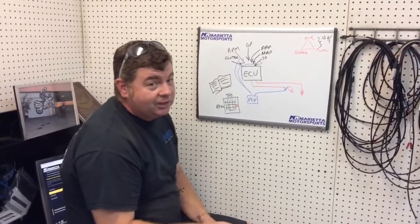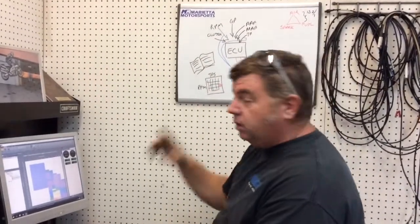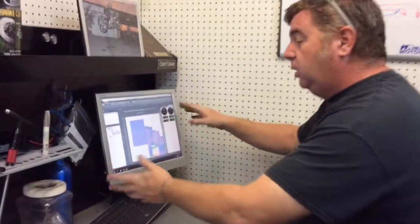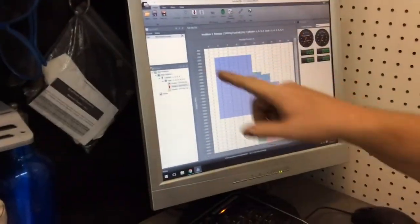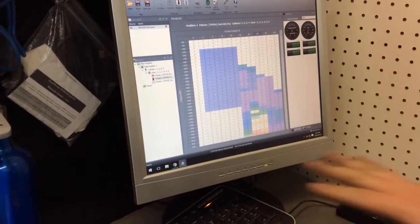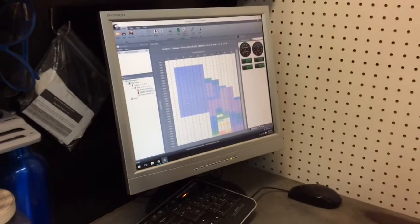And we'll cut here with the generator. So I'm going to show you what's inside of a Power Commander. Like we talked about, it's based on throttle position and RPM. This is what it looks like inside. This is the map. The reason it's called a map is because if you did it in 3D, you'd have throttle position, RPMs, and then pluses think of coming up and negatives is going down. So it ends up making a terrain, a map.